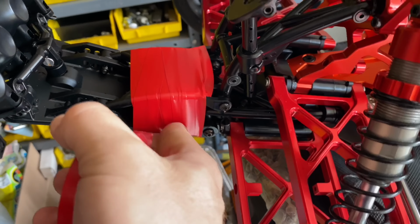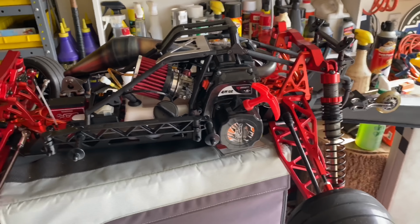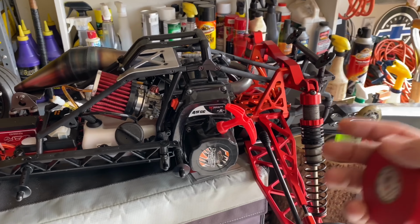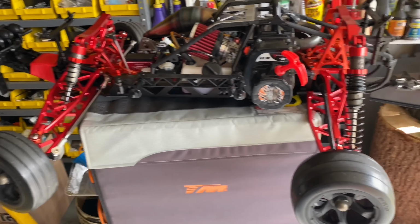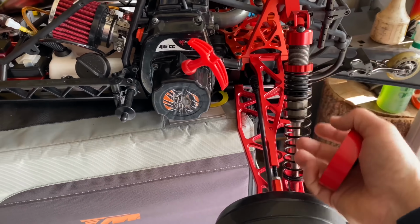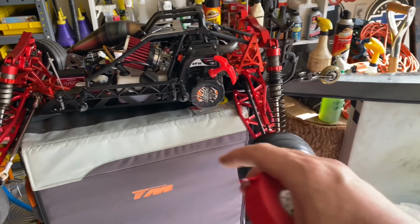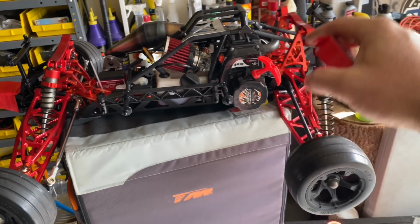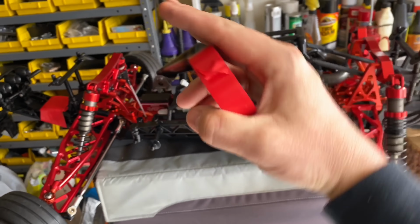All right, this is just for now. Another thing that helps is the shock oil that I'm using. If you put thicker shock oil, it's not really going to help you too much, you understand? So lighten up the shock oil a bit. You can still adjust your spring tension to your liking, but as you've seen in the other video, if your tires hook like these sticky tires, you saw how it squatted. That's all energy that, if it didn't squat like that, would have lifted.